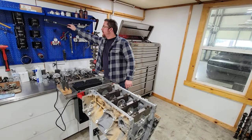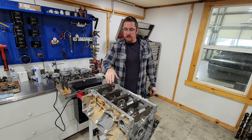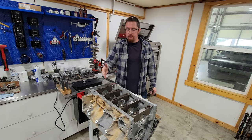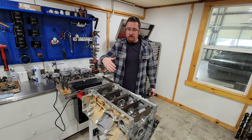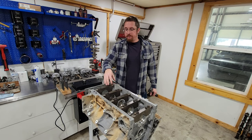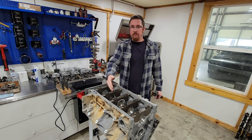Now, before you guys get started on me for reusing torque to yield bolts, I think there's a little understanding to go into how you can reuse these. If you try to yield these bolts again, you'll most likely break them. If you torque them to just a torque spec with lube and everything else that's underneath that yield point, you can reuse them. Torque to yield is basically they've calculated out whatever angle you need to go up to the point of yield of the bolt, where it's a maximum stretch, maximum clamping force, so it can hold these things down. Now, there's obviously an overhead built in on all of these things, 20, 30, 50%, whatever that is, to where we can still use the strength of the bolt that is left in a lower torque setting and still have the clamping force we need to keep these caps where we want them.